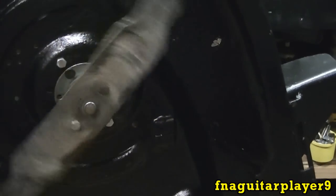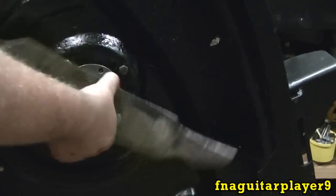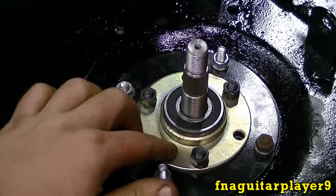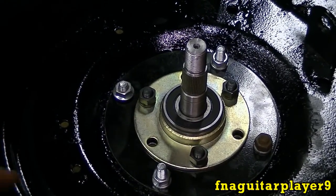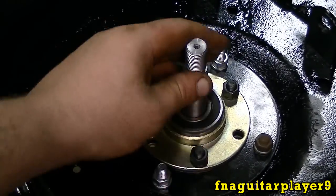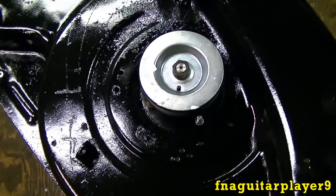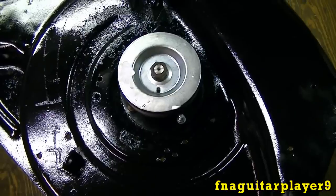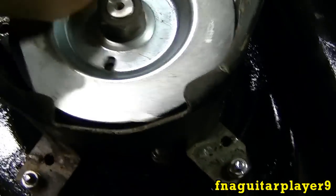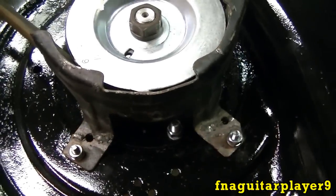That's about it. Be very careful with the blade. As you can see there's no play at all in there and it's spinning very free. Also, double-check these three bolts that hold the bearing flange on — on both of these quill assemblies, one of them was loose, and there's no reason for one to be loose. Always check all three to make sure they're real tight, because that could eventually start working loose and cause your bearings to wear. Now I just got both quill assemblies in and I'm going to put the belt and belt guard on. You always want to put your belt and belt guard on at the same time so you can get the belt on. It's pretty simple — just two bolts to hold it on, just make sure nothing's rubbing.